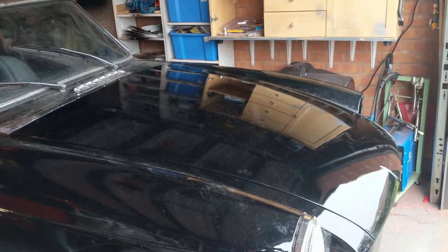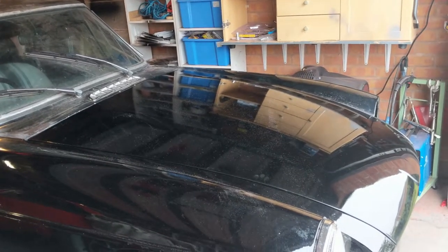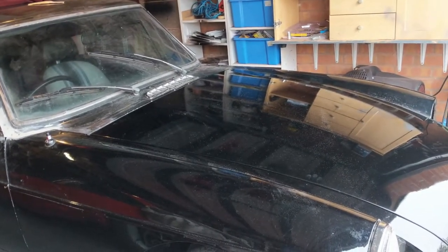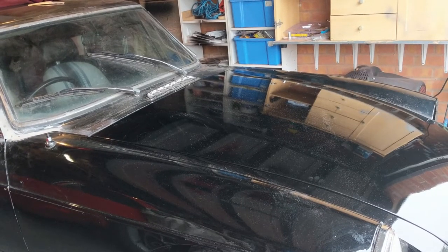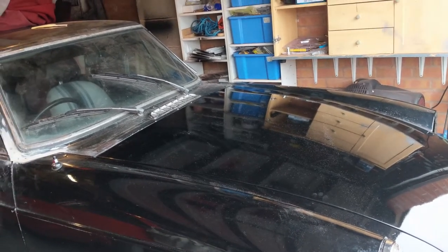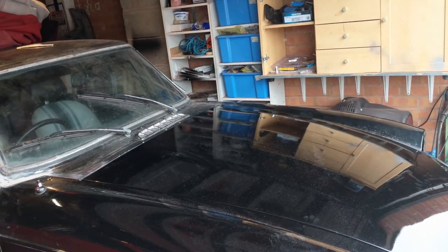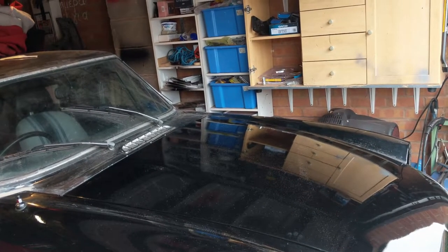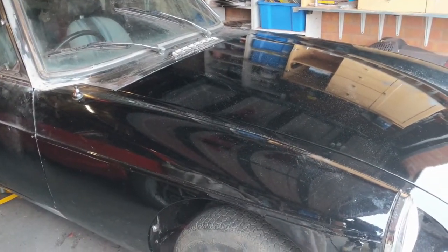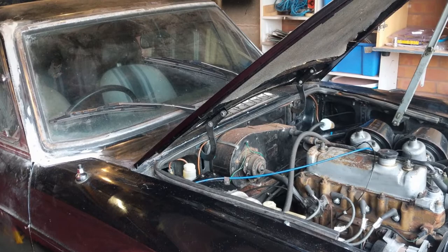I suspect - or hope - it's that my clutch isn't moving enough; the clutch pedal cylinder just feels so light. General view: two things to check. Since the wheels appear to be turning and I appear to be able to shift gear at least forwards - first of all, that I've fully bled the clutch system so the slave cylinder is moving the full amount, and secondly that the transmission has fluid in it, so the gearbox. We're going to have to lower the car down to do that.